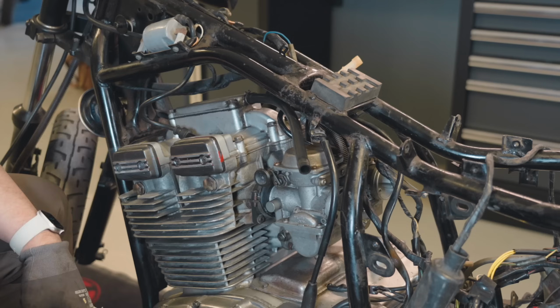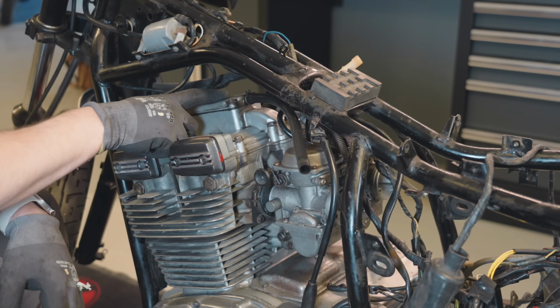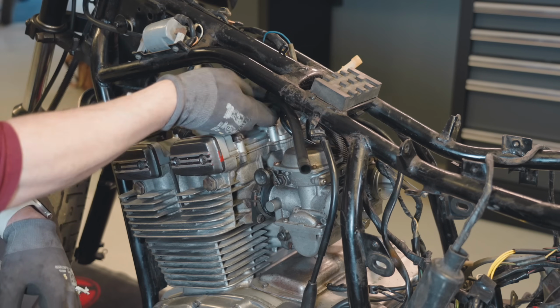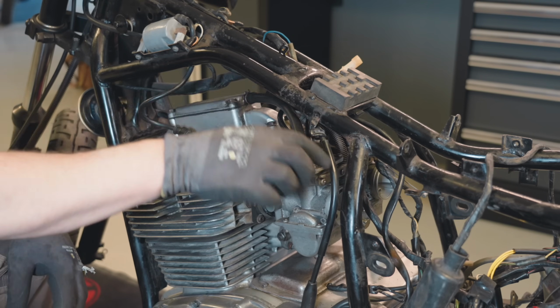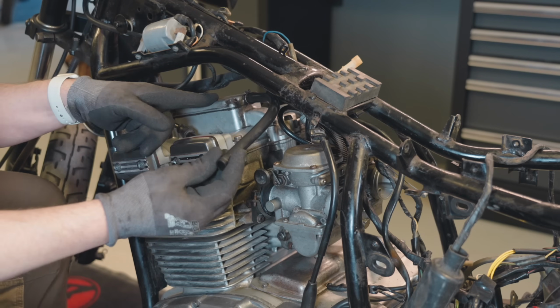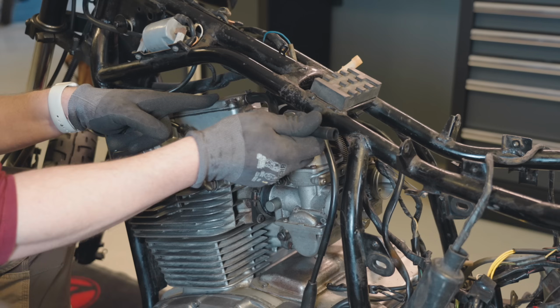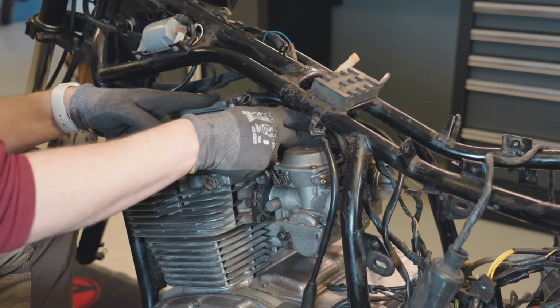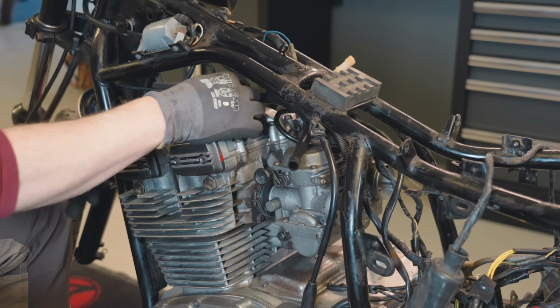Yay. I also found out that this part, which I don't know the English word for, but vevhuset in Swedish, has a ventilation. So this hose is the ventilation to this part of the engine. And it previously went into the air filter box, which I don't have anymore. So I will have to put a filter on here.